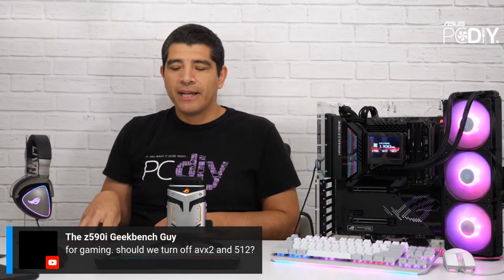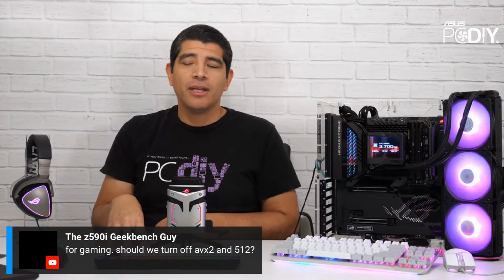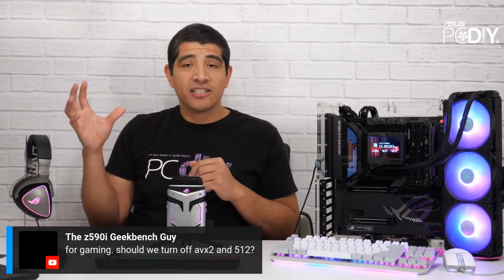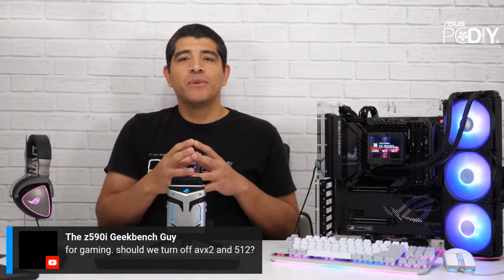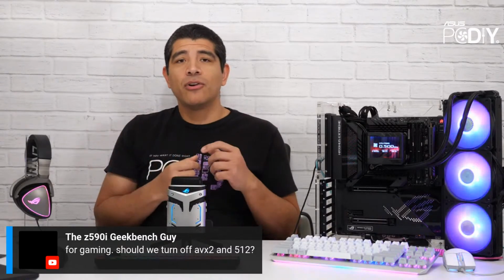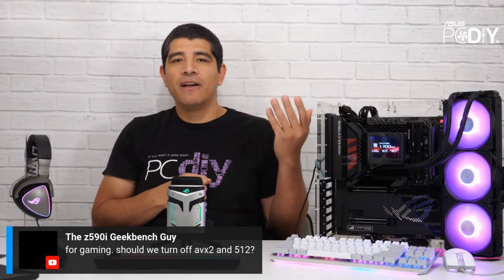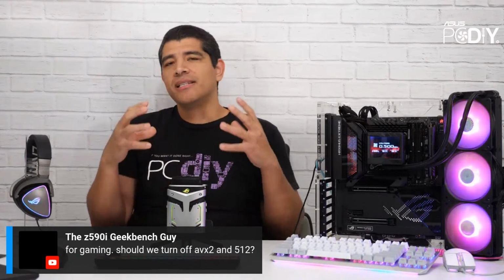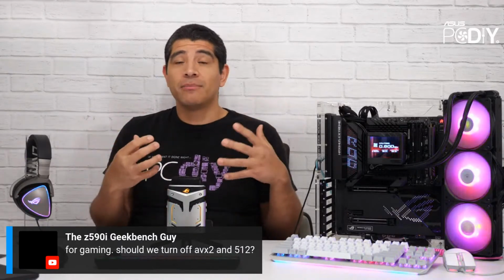The more important thing to keep in mind with something like AVX is whether you're limiting your overclock because you're using an AVX load to test with. When we developed AI overclocking, in our most recent versions, while we have an AVX offset built in to bring down the frequency, we don't want to limit the actual headroom of the overclocking support, because we know that under games you're not going to be affected by that. So there's no reason to limit your frequency. This is why you'll see 5.3, 5.4, 5.5 gigahertz overclocks, which some people think aren't realistic because it's too hot. It's not too hot, because the delta between an AVX-based application and a game could literally be 40 degrees, sometimes even more.